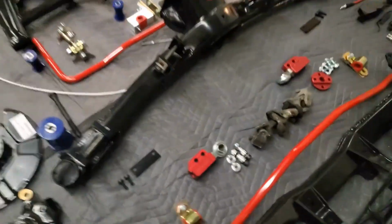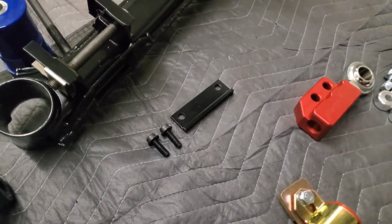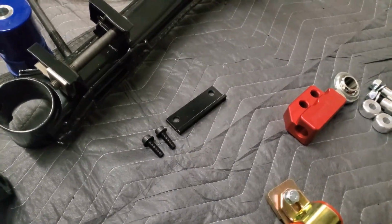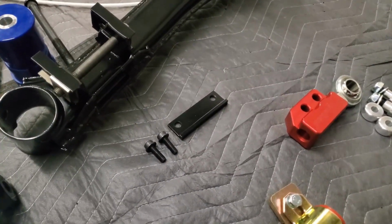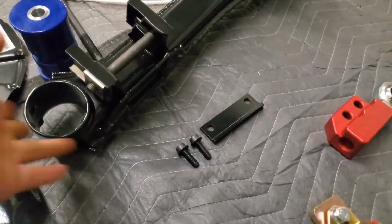Also in the rear, Race Germans rear jack point. Highly recommend, not sponsored, but it just gives you another place to jack up your car from instead of having to use either the diff or ruining your pinch welds. So highly recommend that. That goes on the brace that mounts to the subframe.